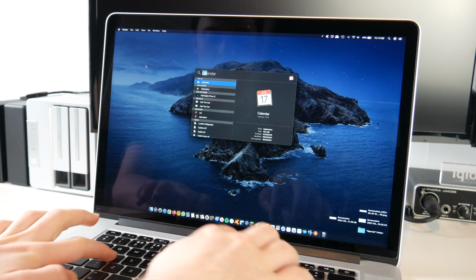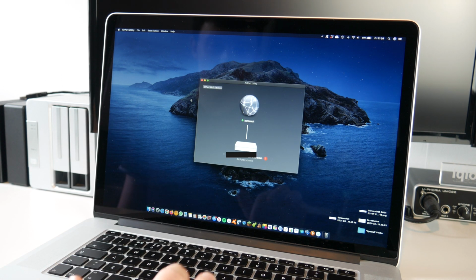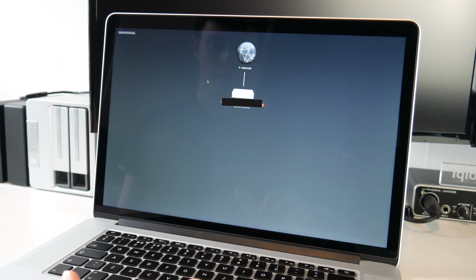Okay, so here's my MacBook Pro. Let's open up the AirPort utility, and it has found it, and it's got the person's name there, and it's now just gone green, meaning it is online. There is a password on it. I don't know the password, so I am going to have to reset the device. I will go get something so I can poke the little button.